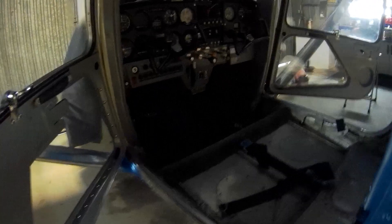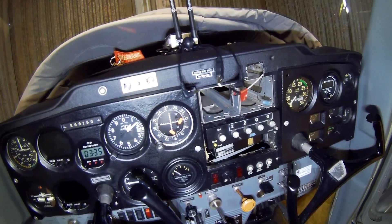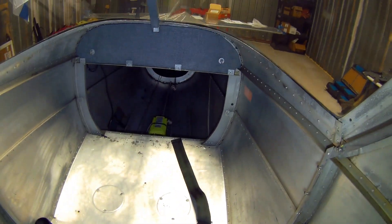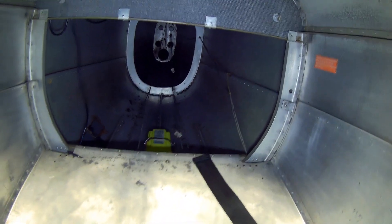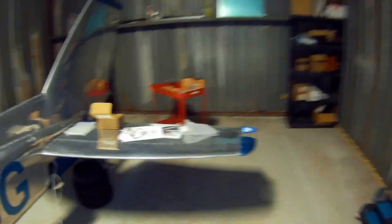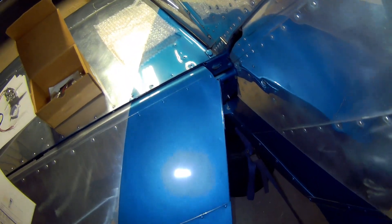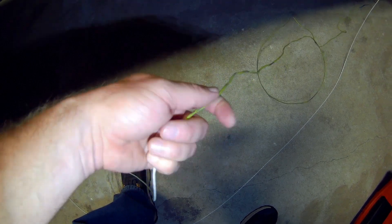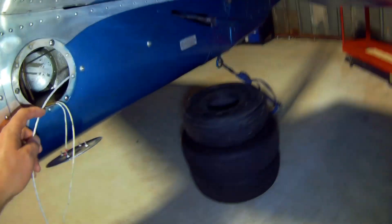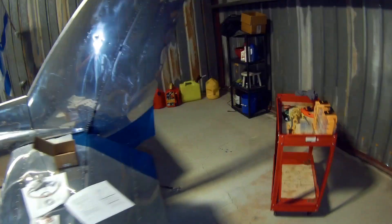We've got the interior out, part of the panel opened up, and the first thing we're starting with is installing the Tail Beacon X. We got the tail cone open - the hard thing was going to be fishing the wire down in there, but I was told the really hard part was actually getting the wire from here down and through. I had no trouble doing that. I attached my new shielded wire with a heat solder connector to the existing nav power wire so I could pull it through.